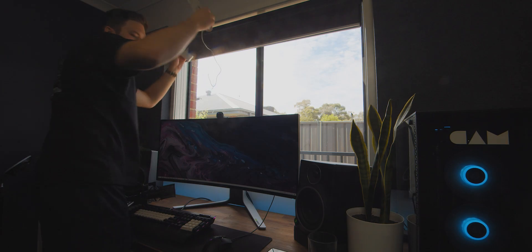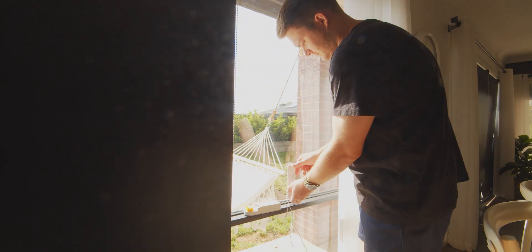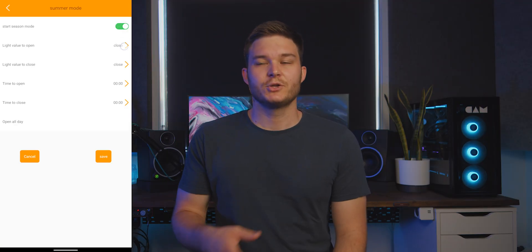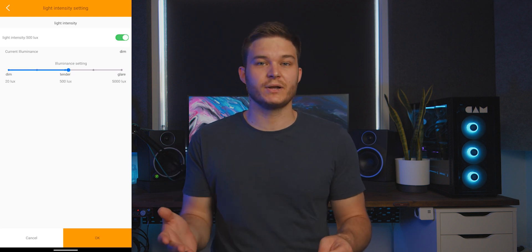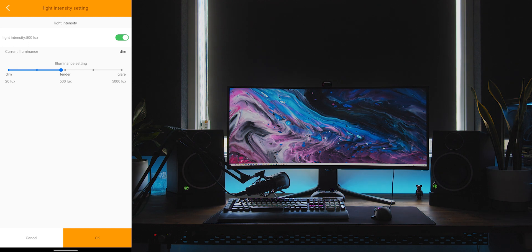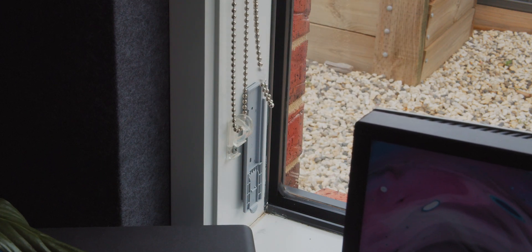I want you to leave a comment guessing how many days until it goes flat. I moved the unit to a window with direct sunlight, and after five hours the battery was still at 90% — no charging. I also tried using the solar panel for automatic sunrise and sunset triggers, where you punch in the lux level to trigger it, but it seems reversed — it would close the blind in the middle of the day and open in the afternoon. The app wouldn't let me do it the other way around. So the solar panel is only useful if you want the blind to close mid-day, not for sunrise or sunset triggers. I'm not going to rely on it for charging or functionality, and the unit is much cleaner installed with no cables anyway — I'm happy to remove it every few weeks or months to recharge.